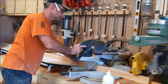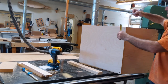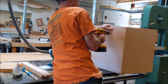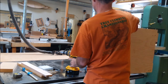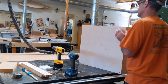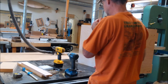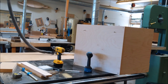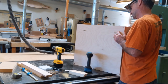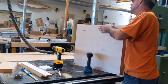I have that top rib and support in there. Dropping the black box in — it's actually a pretty good fit, not perfect. I cut a few more ribs and put them in, both on the bottom and the top, to make sure I have something to bolt to the frame and that it's really solid. That black box with a small generator is going to be really heavy. Then I realize the propane is not going to fit. I grab a spare tank from the back room and confirm — yep, not going to fit. The front ribs are going to have to come out and get turned up on edge, and the back rib I'll cut an arc out of with a jigsaw so the propane bottle can fit down from the top.